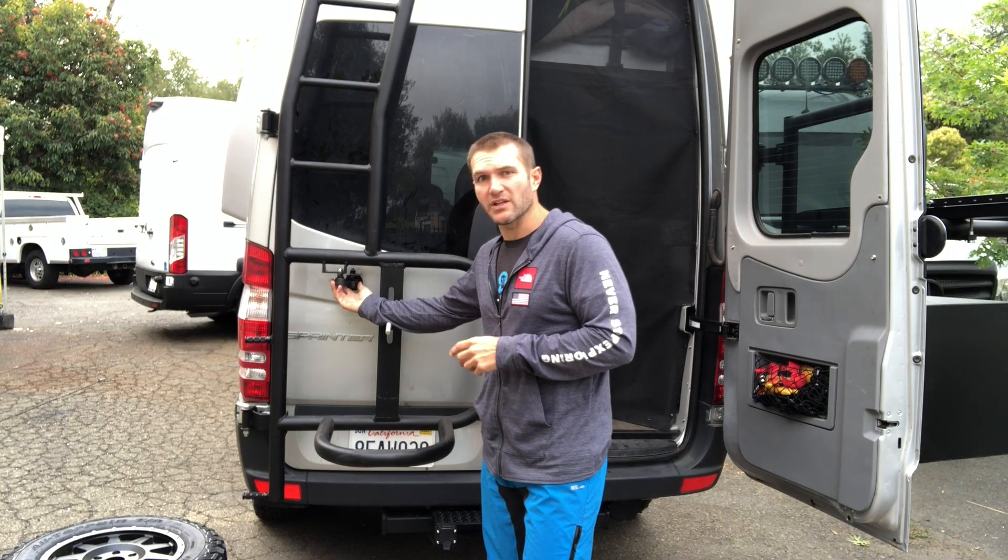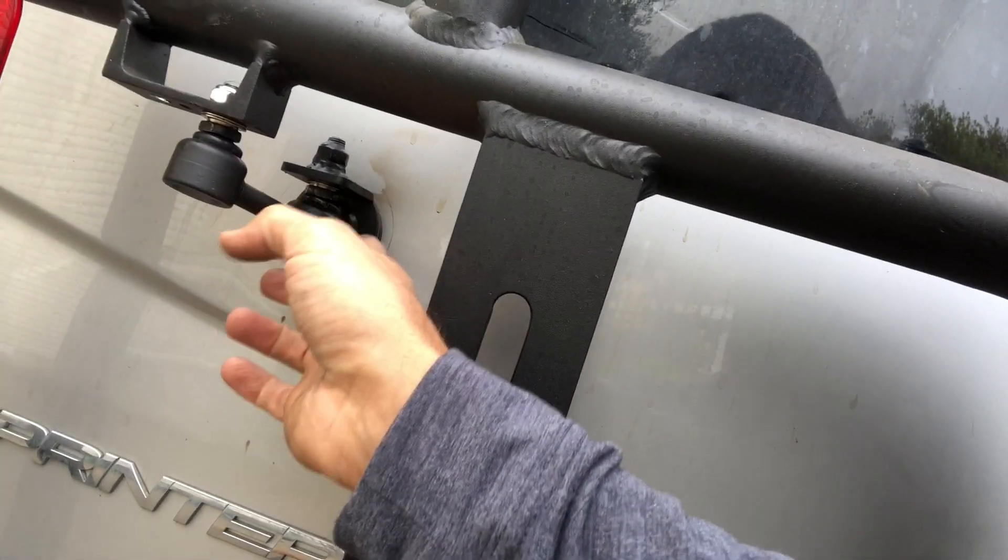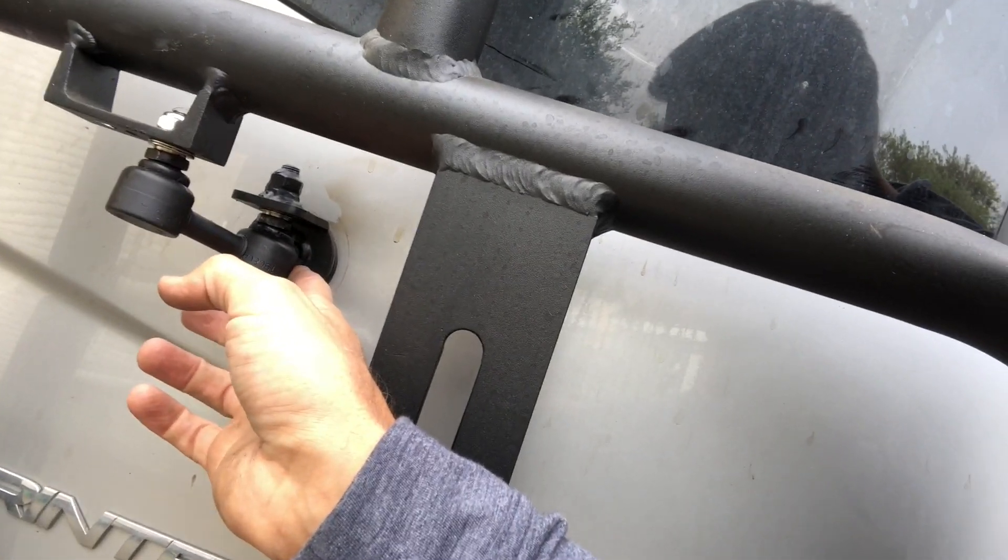So it goes: outside hinge, metal washer, plastic washer, the main hinge that goes to the bracket, and on the bottom you put the nylock nut. Once you put the nylock nut on, there's a little up-down play — tighten this down so there's no play. The hinge will squish down a bit onto those washers. You don't want it so tight it's hard to move, but tight enough so there's no up-and-down play. It helps to have two people even though it's quite light. Once those are tightened down, thread your sway link through the door — the sway link is upside down by design — and use the nylock nut on the back side. Make sure that's nice and tight.